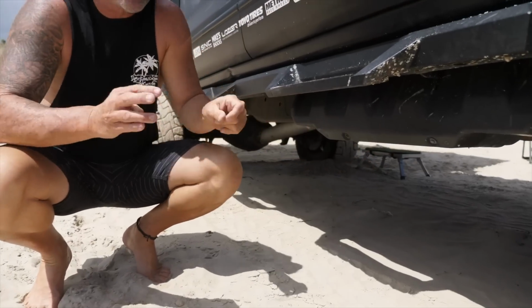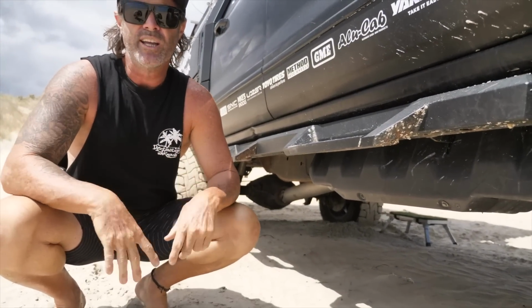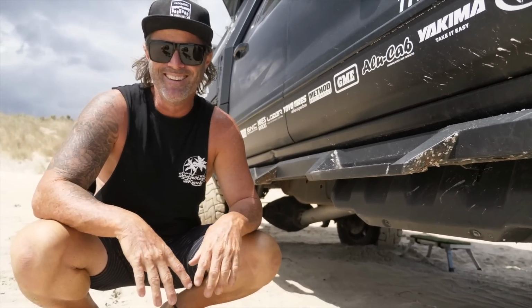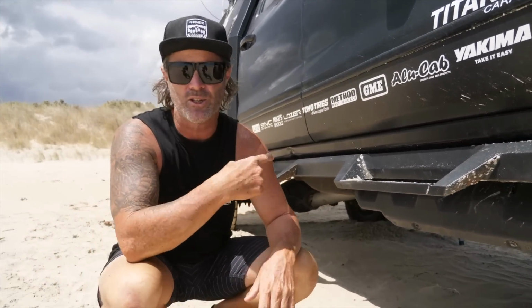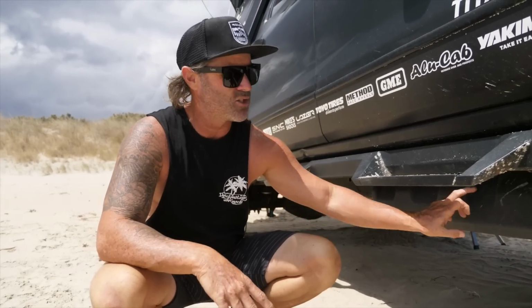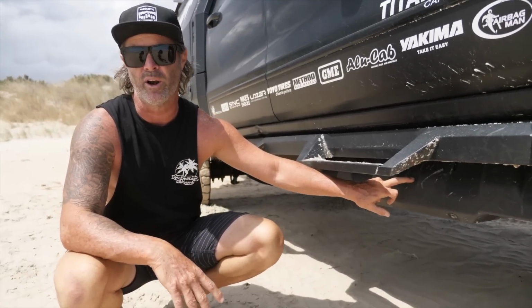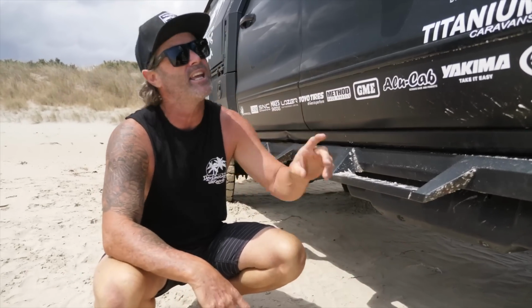We probably should get into it, because people ask us all the time what that big thing under the front is. The big tank under the driver's side is the AdBlue tank. AdBlue is just an emissions control. It's basically urea, injected into the exhaust way down the back, and it's supposed to get rid of the NOx gases. These trucks were fitted with the tanks here, I guess because they didn't want to redesign an entire truck, so they put a tank here and the filler is under the bonnet, which is why so many people ask us what that thing is.